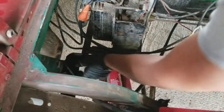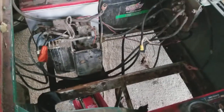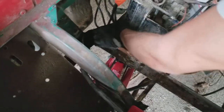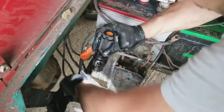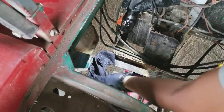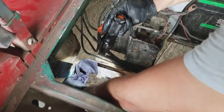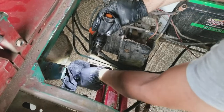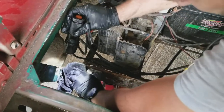That's the end of our roll. There's a piece at the end that's wrapped back over itself — if you pull that, you get a little more out of it. We're going to hook it to itself. We'll take the black plastic that comes with Fiber Fix and push and smooth this together with our gloves as it dries. You basically rub the pieces to each other so they bind. In some occasions when I'm not binding it to the metal I've had to use two wraps, but in this case if we push it together well I think it'll hold pretty solid — you can't even cut it once it's dry.